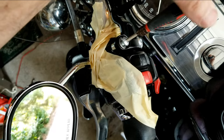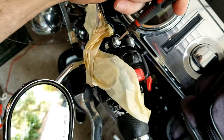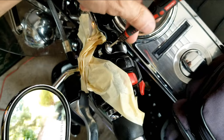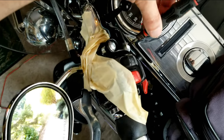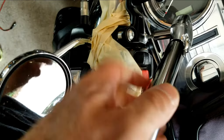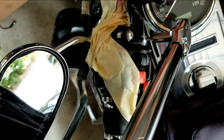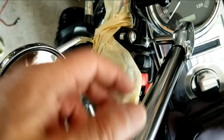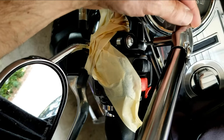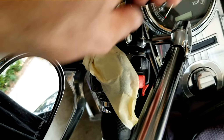That way it'll go right in. I'm just using this little tool to snug them up. It's asking for 60 to 80 inch pounds torque spec. Since I put tape on here, this hasn't moved at all. On these kind of components, I go with the lower end of the torque spec — the range is 60 to 80 — just because I want to be able to get this stuff loose later. On more critical components that absolutely cannot come loose, like around your air box, I go with maximum torque spec and possibly even a dot of blue Loctite.